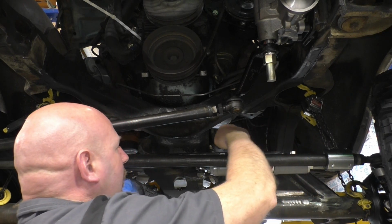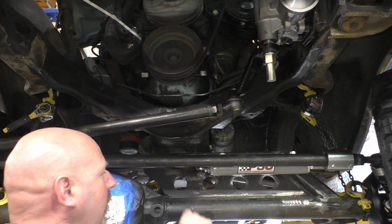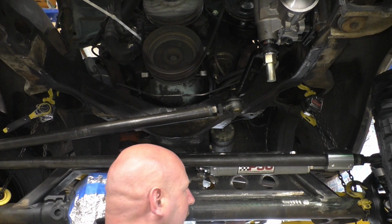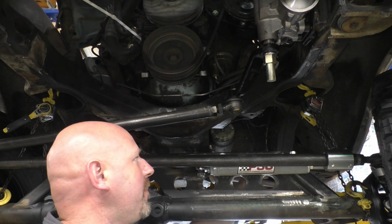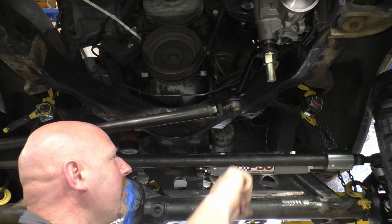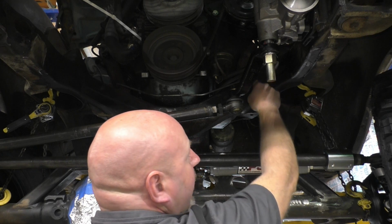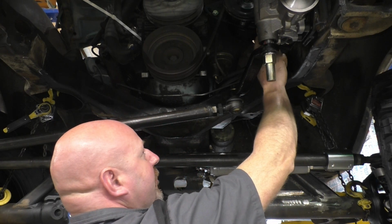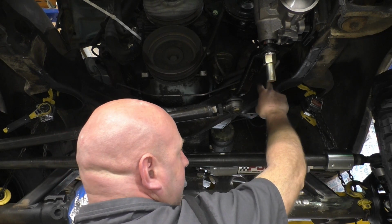This one's going to come over this way, and it'll be down next to this one, and it's going to go down through this hole, and then they're going to go up the upper control arm together, and do a U-turn back about 3/4 of the way up it and hit the frame, so there won't be that much motion that far up the control arm. Then they'll go up the frame, and I think I'm going to put a pass-through hole here, and then they'll come through the hole and up to their fittings, which go right there. And then I'm going to move all the fuel line fittings and stuff down through that pass-through.